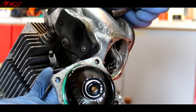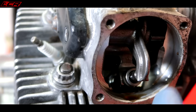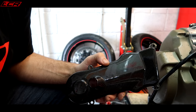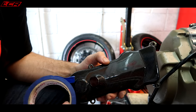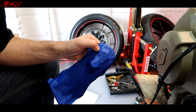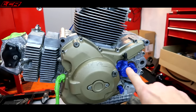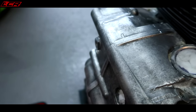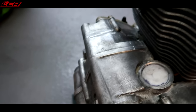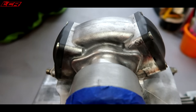Oh, some valves — no gunge in there, that's good news. As part of this job I'm going to check valve clearances and stuff when things go back together. Once I've painted it, I'll change the belts and check the valve clearances. It's time to mask up the belt covers. There we go, ready for refitting. Well, there she is guys — the final finish. Clean, sanded, masked off. I think we've got a pretty good finish on this now. This has been about six to seven hours of work to try and prep this. It's been a lot of effort. Let's do it.